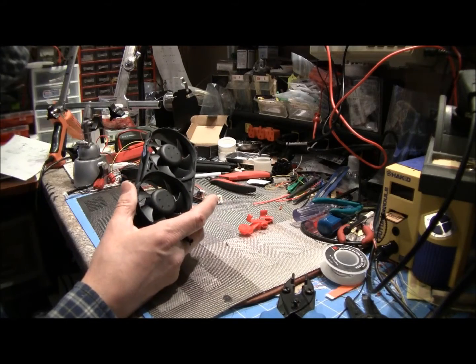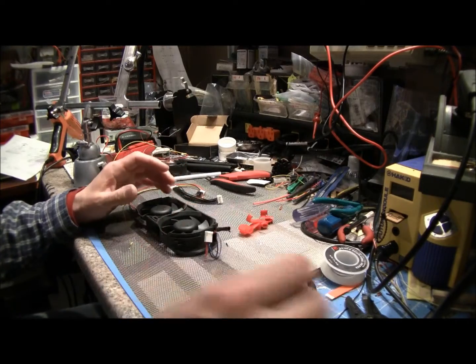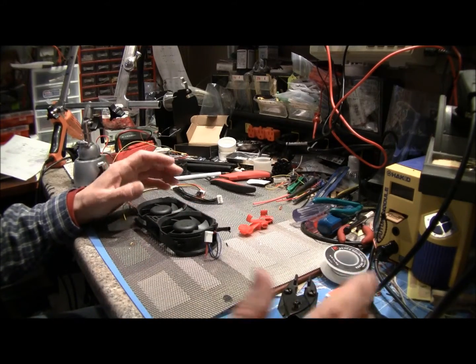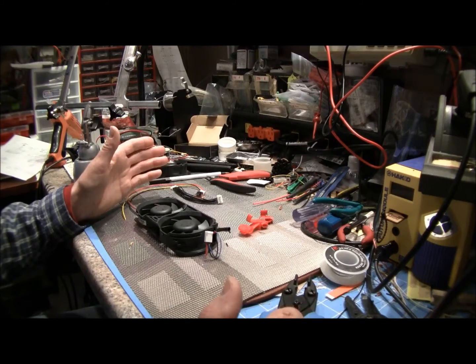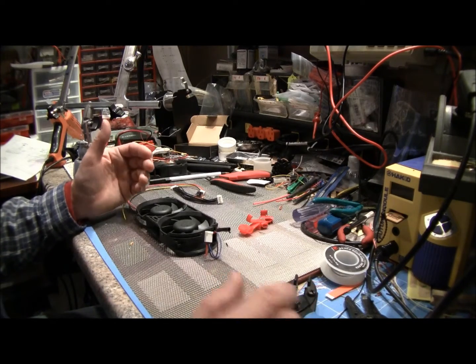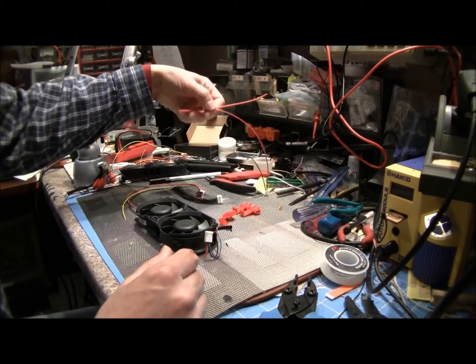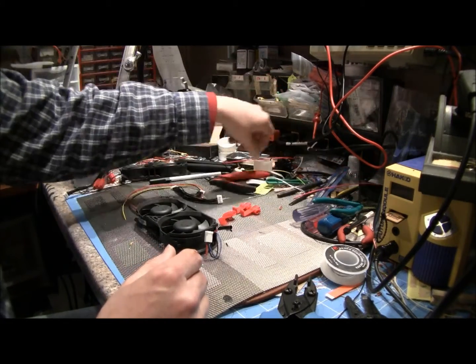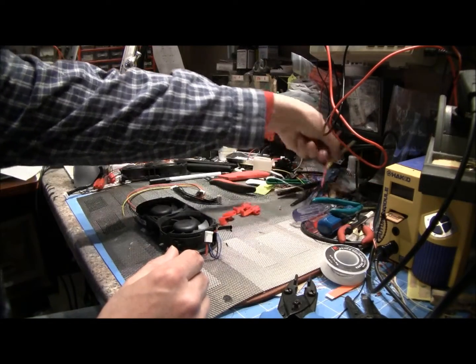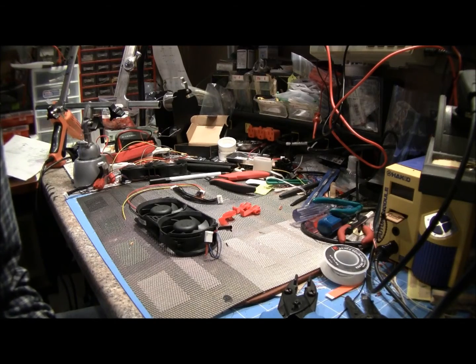By forcing the fans to run at full speed, you basically take away the ability to determine if your unit is overheating. In other words, you will never know if your unit should be running at full speed or not, whether it's overheating, whether it's cool. You will have no real way of telling that other than maybe putting your hand back there or trying to find out what's going on with your system. And taking away the ability for the user to know how hot his machine is is a problem.